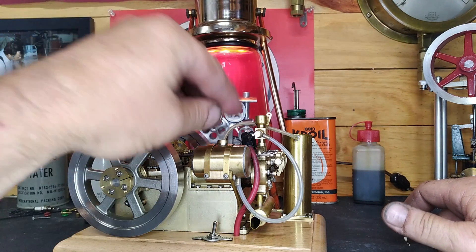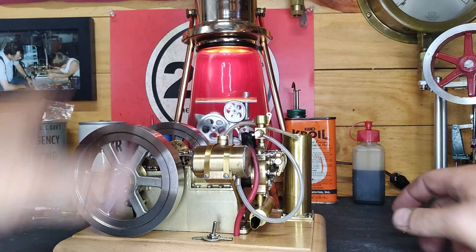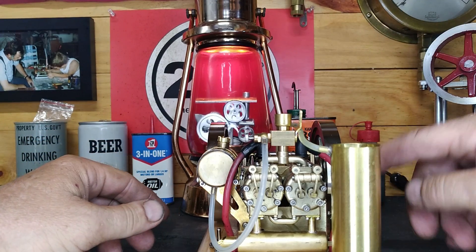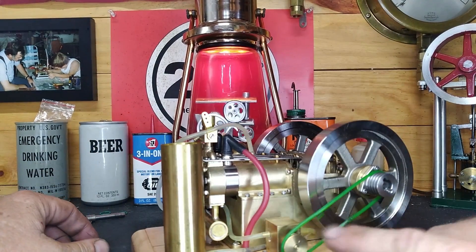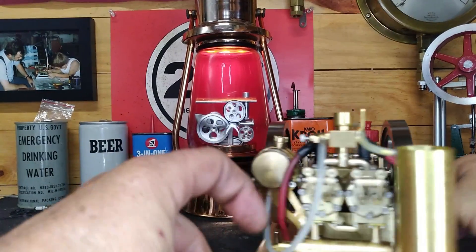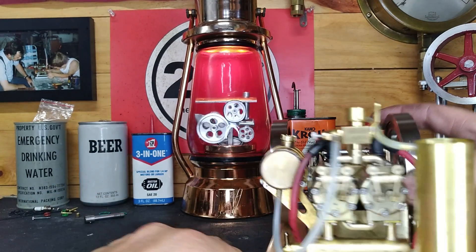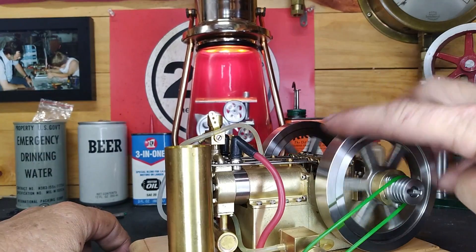There, that ought to be plenty of fuel. Get our cap back on here, then I'll get the drill-start attachment and we'll get this guy turned around and fired up. What I did when I monkeyed around is I retarded the timing a little bit so it was firing closer to top dead center versus before top dead center. Our belt back here for the water pump broke, so we've got one of those green PU belts running our water pump now. And the intake manifold — I noticed it wouldn't idle down as far as it should, throttle all the way closed, running lean. It was an intake manifold gasket leak, so we pulled those out, replaced the o-rings, and surfaced the mating surfaces. That took care of our vacuum leak.